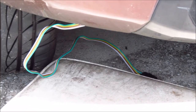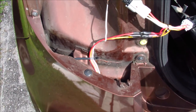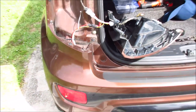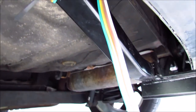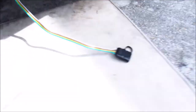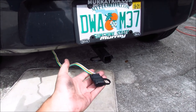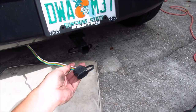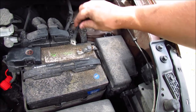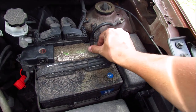You can see the excess harness hanging out from underneath the bumper — I've zip tied it off so it can't fall any lower. We can go ahead and reinstall the driver's side tail light. Back underneath the car, I've looped my excess harness around the trailer hitch bar itself, leaving a generous amount hanging since I need to hook up the trailer and see how long it needs to be. Anything else can be zip tied back — just make sure you leave enough excess line. Since we're all done, go ahead and put your ground cable back on and tighten the nut down completely.